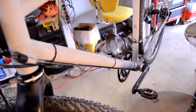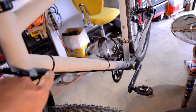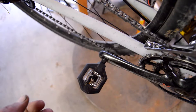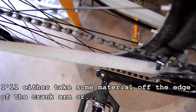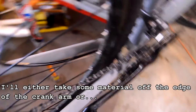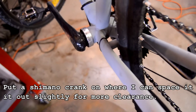Next time I may do internally routed cables, or if it's a dedicated mechanical build, I may do a cable stop right here and then run a cable guide with another stop near the brake. Those are a couple of different ideas. One other minor issue you can see is the pretty close clearance — if I really stand up and sprint, the crank will actually hit the frame.